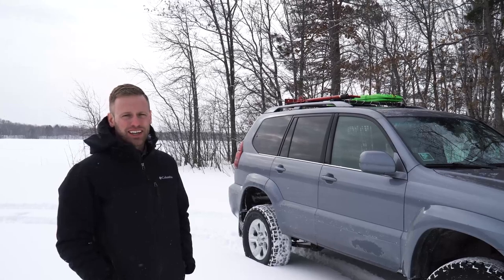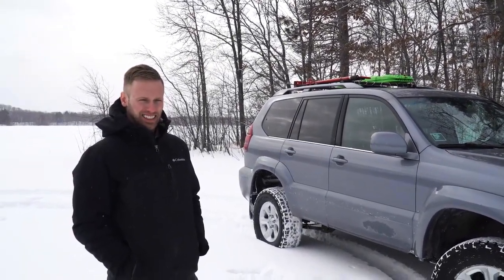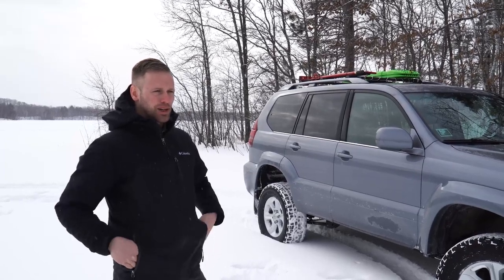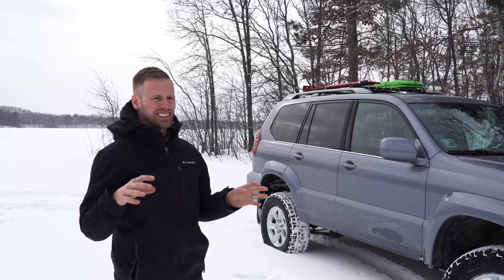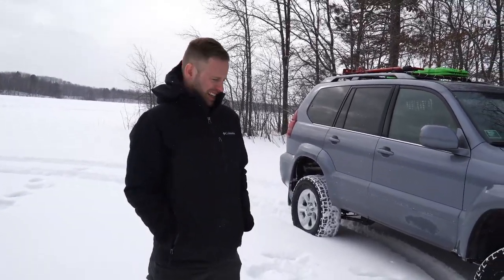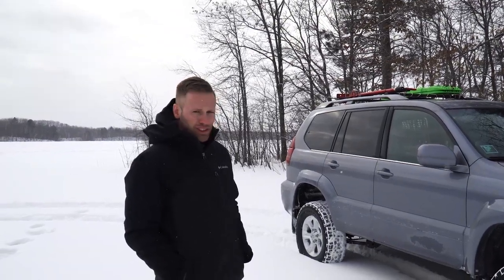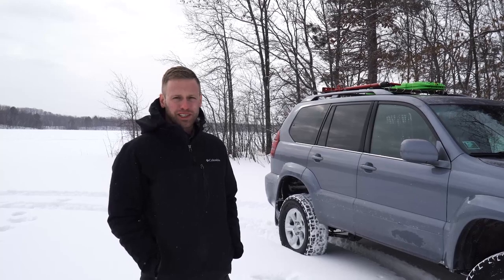Oh, true. So I have Ironman Foam Cell Pro shocks on there. Okay. And it's a pretty wide body shock, and because of the foam cell in it, it has more oil volume, so they're pretty fade resistant. Okay. But the front's adjustable. The rear is like a 3-inch lift, and the front is about a 2-inch lift.